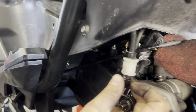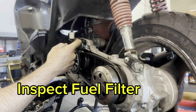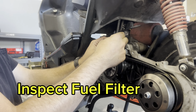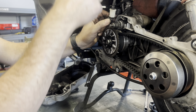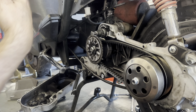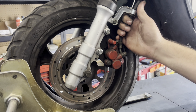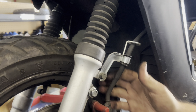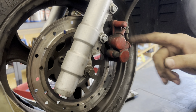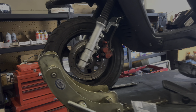Next we're checking the fuel filter — Adam's is just dirty on the outside. You're checking to make sure it's got enough gas flow going through it. His scooter has a vacuum pump underneath the gas tank, so he checks that regularly. On the front of the scooter, you should be checking your brake line after a year, and also checking your brake pads periodically.